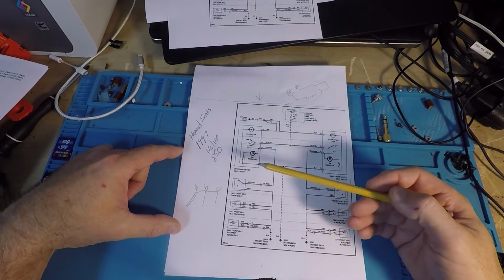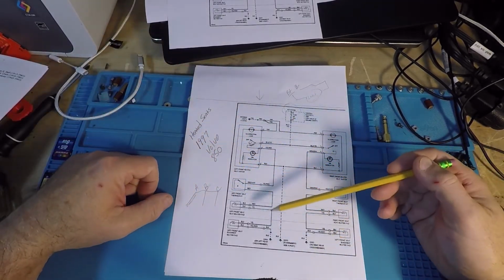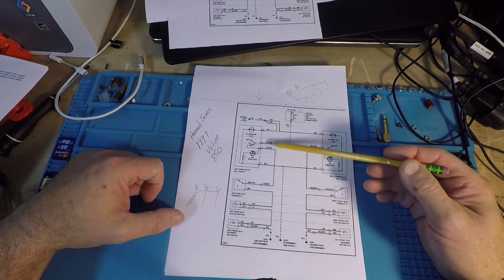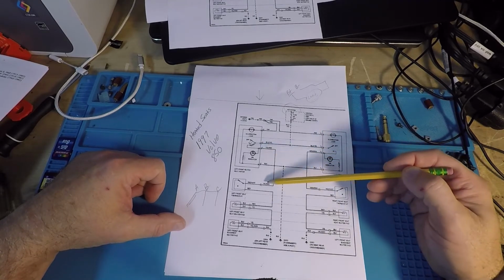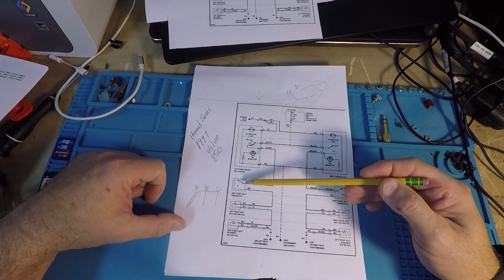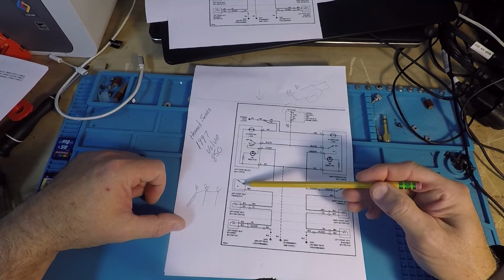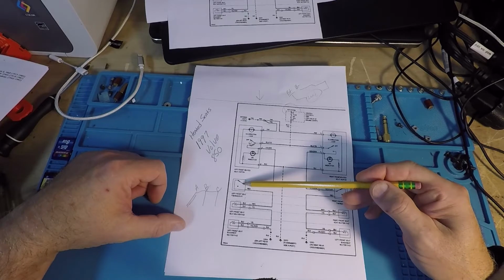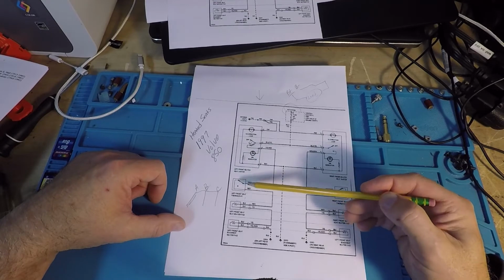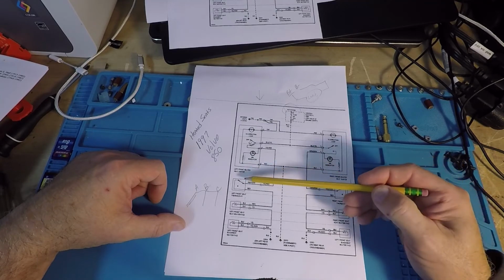It looks a little bit like a turn signal flasher on an old school, just round with 2 pins on the bottom. And it acts a lot like a turn signal flasher, except it doesn't pulse as often, but it has the same kind of methodology. So if you come down here, thermostat, let's say it's in the 30s or 40 degrees outside, because once it gets above a certain temperature, it just doesn't work. You come down and the thermostat is in its good position. It's ready to power the seat. It jumps across this connection right here, this switch, so whenever the thermostat kicks out, it goes to this open, no current flow position. But as of right now, everything's good.